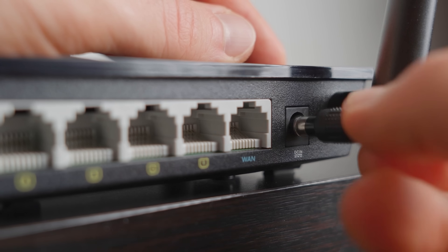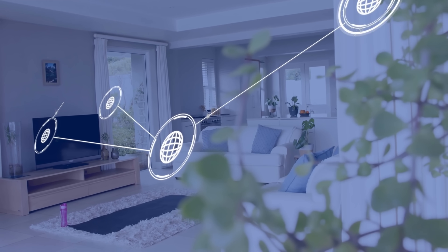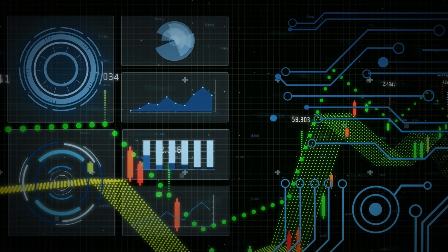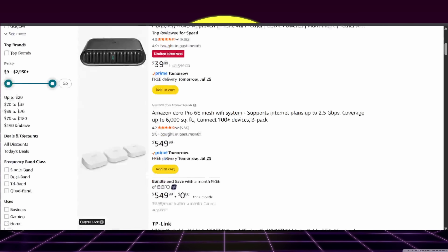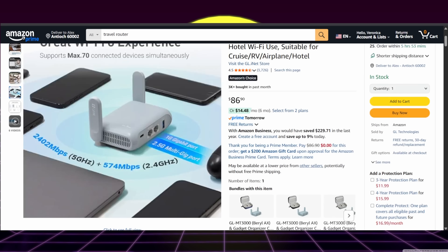Another no-brainer would be a good network router. When I say good, I don't necessarily mean best of the best — I mean something that works for you now and can expand from there. Even DIY units like OPNsense make sense here. Your router is the gateway between your home lab and the world, or just the rest of your LAN. A dedicated flashable appliance lets you build real-world networking skills — VPN tunnels, dynamic routing — while giving you total control over traffic, security, and segmentation. Create granular rules to isolate your sandbox home lab VLAN from your production lab or lock down remote access to specific services. And if you're on the road a lot, a travel router that connects to hotel Wi-Fi and routes all your devices through WireGuard or OpenVPN keeps your traffic encrypted within a secure tunnel.